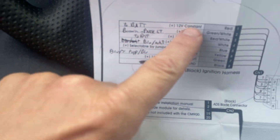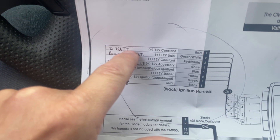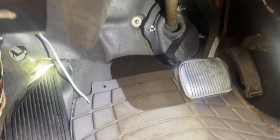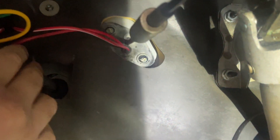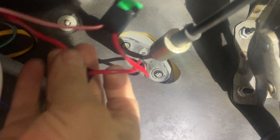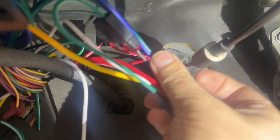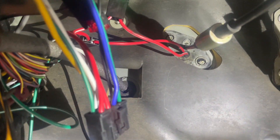So reading what they say: 12-volt constant is your red wire - that's going to your battery at all times. I ran those through the firewall. We're down here under the dash; I haven't had to pull any panels at that point. I went up here - this is my cable for a nice rubber connector, either a hood latch or a brake cable. I just poked a hole through the rubber and I'm running my two powers through there. They're on a 30-amp fuse. The whole harness that comes with the kit - the box - I'm going to have it up under here into the dash.